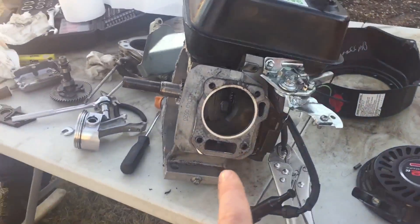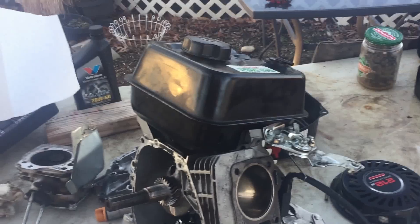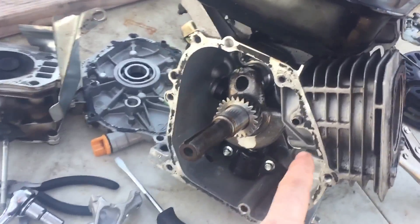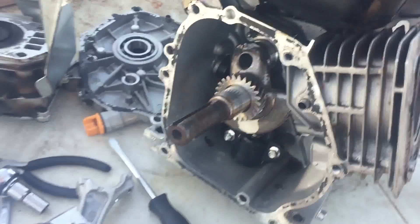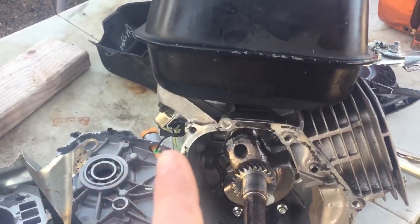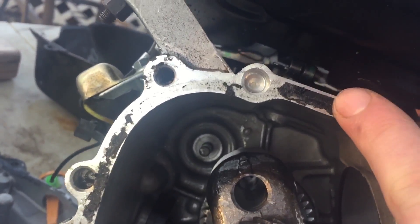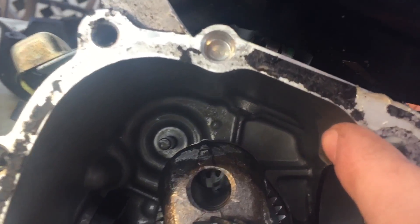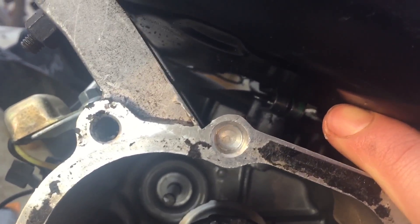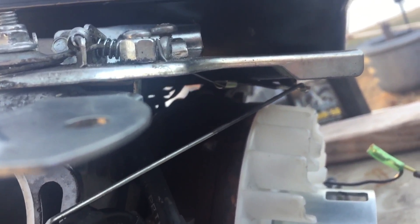What I'm going to do is order a new carburetor because the other one's all messed up, and maybe some new gaskets. I'm also probably going to drain the old gas and put in some fresh brand new gas. I'm also going to scrape off all this old gasket material. Shout out to 3D Machines — he's awesome, I'll put his link in the description. I'm going to fix up the governor arm linkage, because when I removed the governor I took out the governor arm and kind of hooked it up in a redneck type of way to keep the governor arm in so it doesn't fly when I throttle it.